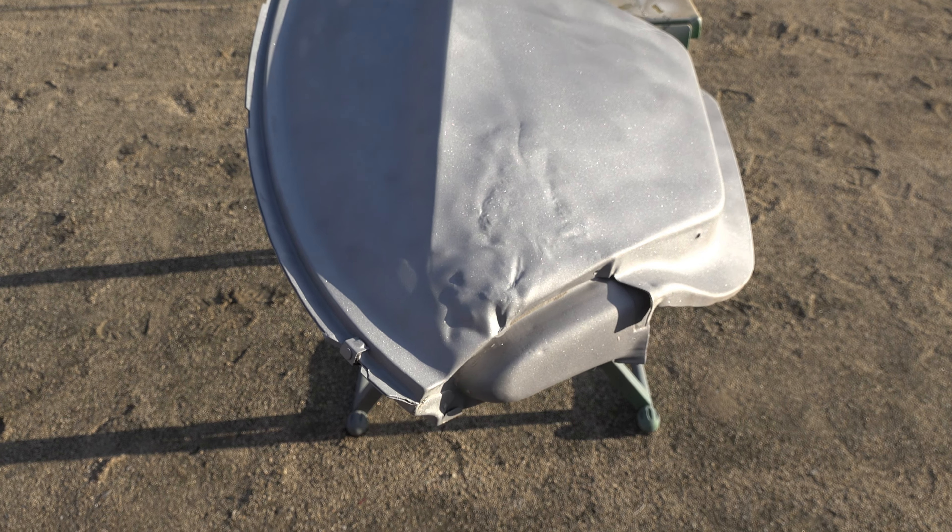One piece I forgot to remove before sandblasting and priming the fenders were these clips for the trim. As you can see by comparing to the new piece, the old clips had lost their springs, so they would definitely need to be replaced. To remove these clips, I remove the nut from the other side, and then gently tap the clips out with a hammer and punch. After adding a little more chassis paint to where the nuts were, it's time to begin prepping these fenders for paint.